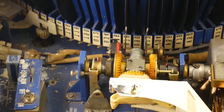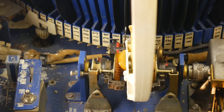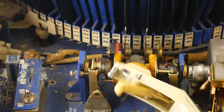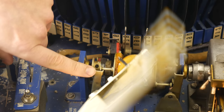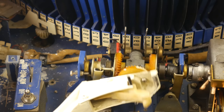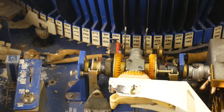Now, the last thing that I haven't talked about yet is how the record changer changes sides. We know that there's a different feeler for side 1 and side 2, but what does that do? Well, as the record changer arm pivots back from the record carousel, it has a sort of weird gear train at its pivot. It looks something like an automotive differential, and there's a pin on each side of this gear train. That pin, when it gets stopped, is what causes the record changer arm to actually start turning as it falls down. That way it goes from a vertical position to a horizontal position.